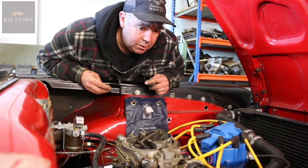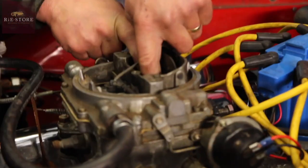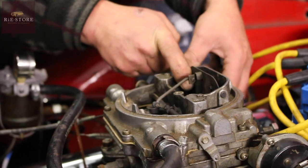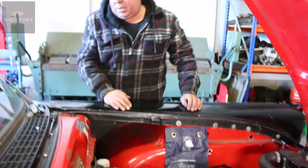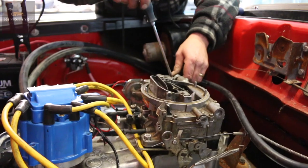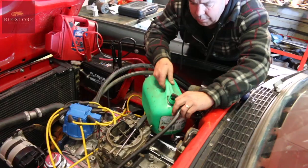I've looked up the Edelbrock 1406, which is what it is. See those two jets there - they should pump fuel in with that off. So you would say that's run out of fuel. If we pump that up again... now that's got 3 PSI, and hopefully that should give us fuel. Which it isn't - not enough in there. I'll take the fuel line off. Mind this doesn't spray. It's very stale as well. Can you just turn the ignition on?